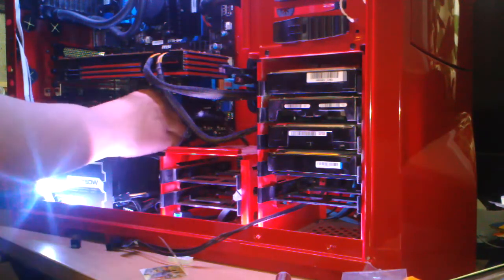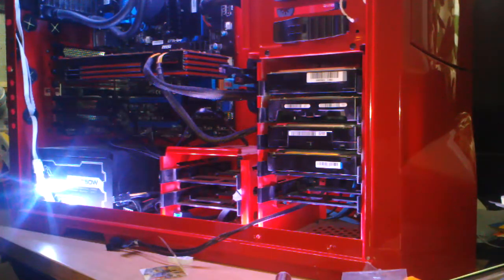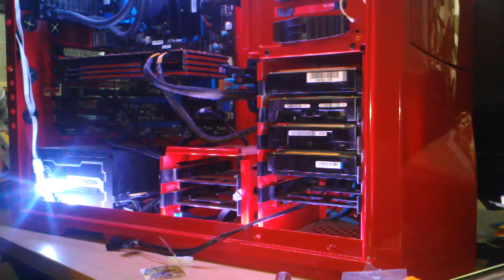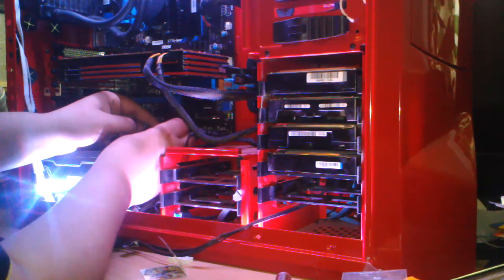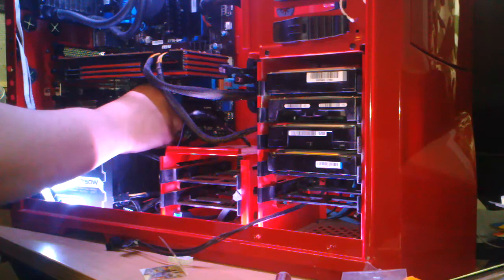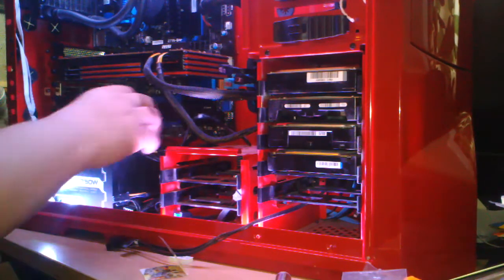Right, so this is where the blank slot goes. So there's one. Actually, no, I won't put it on there yet. I'll show you when I put it down. This last one is going to be a speaker, where did I? Oh, there it is. Fell down. The little speaker there. It gives BIOS beeps. They are useful. Now I'm going to take a stab at this being the positive and this being the negative, like that. It's going to be my guess at it. And then I need to put the power LED on the other one, so this will go positive on there, and negative or ground there. And we'll find out if that's right in a minute when I power it up. When I power up my new toy, so to speak. So that's what I was going to do before I plug these in. Right, to bring you in again.